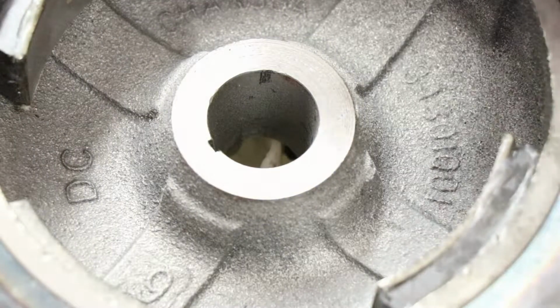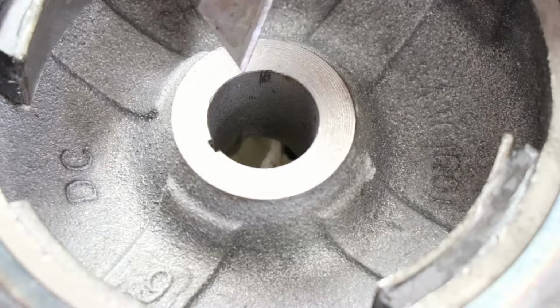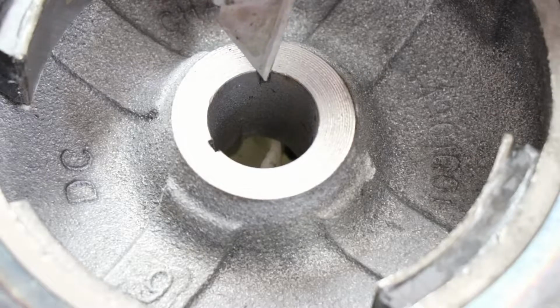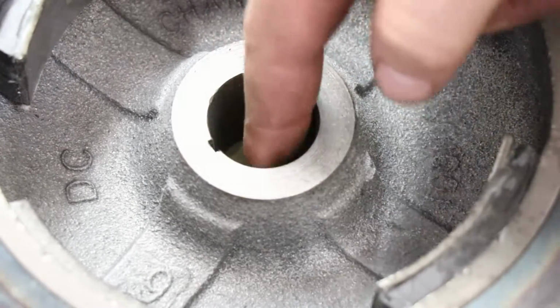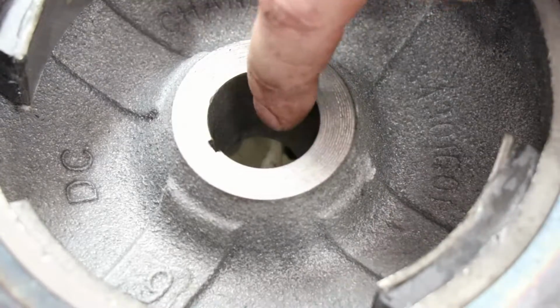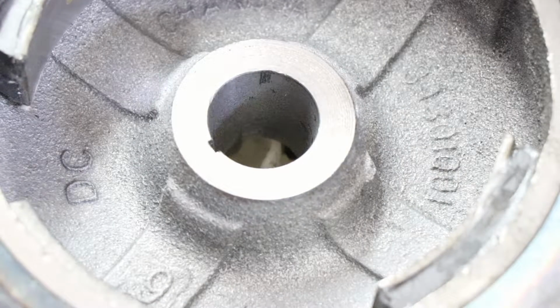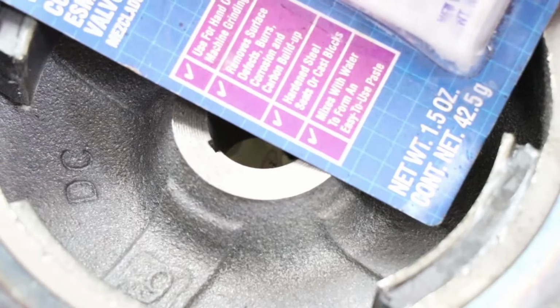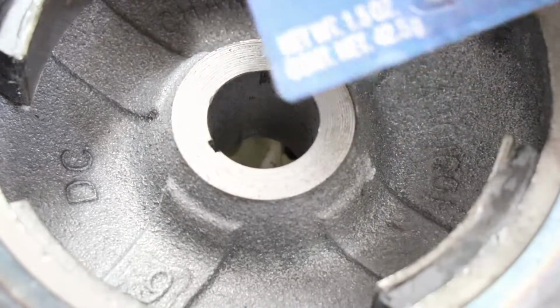Okay, so really quickly, there are a few casting flaws. You can see that there might be a little bit of damage here to the taper. So it's not going to be a perfect fit, and it's definitely not smooth in here where it needs to be against the flywheel. So I would highly recommend lapping the flywheel to the crank. And you can just do that with some valve grinding compound. I have a link to the valve grinding compound in the description.